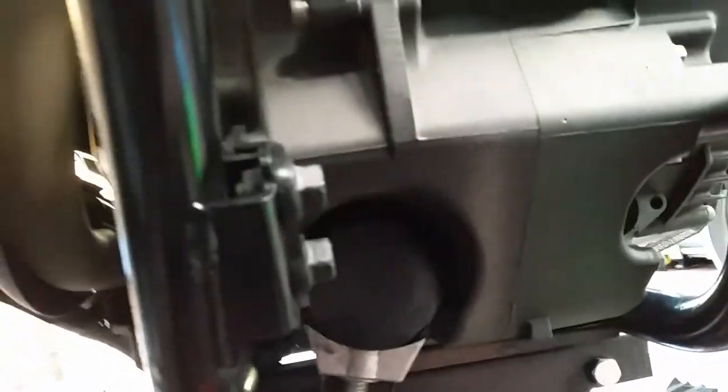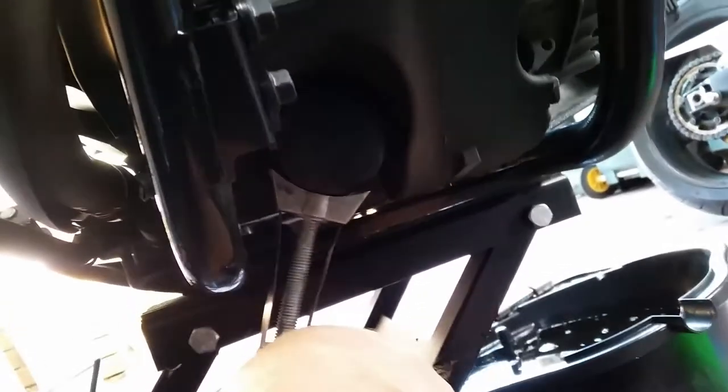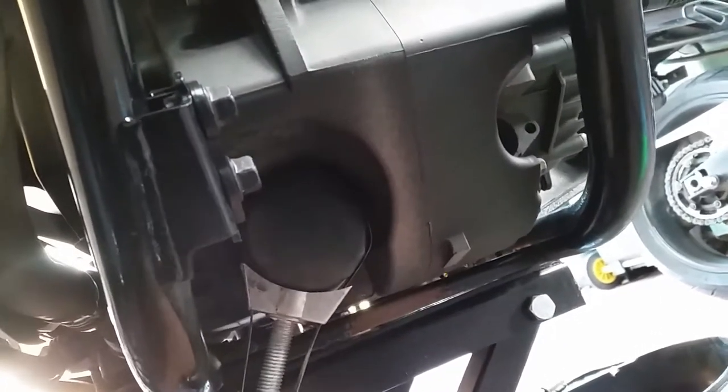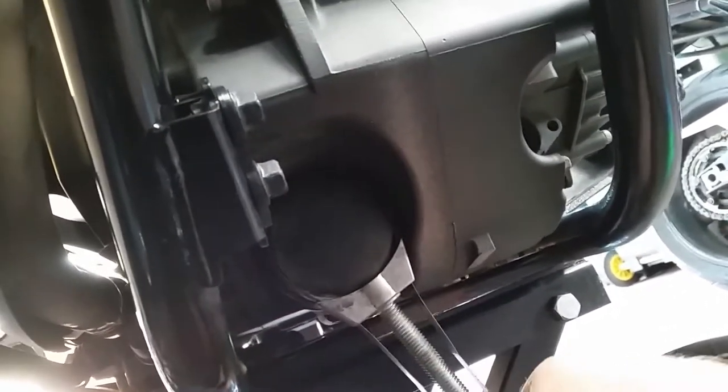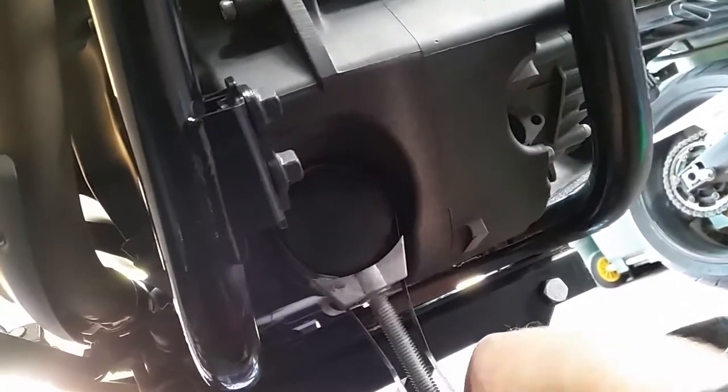There's always oil in the filter. The book will tell you the oil filter's down here at the front of the pipe — you can see it there. I've put this tool on it to slacken it off because it was just too tight. You screw that on, move it, turn it back, tighten it — just keep doing that until it's slack. Once it's slack, don't get it too low. This one doesn't have a nut because this is a genuine Yamaha filter.